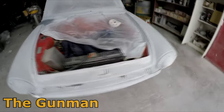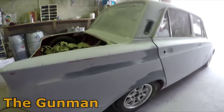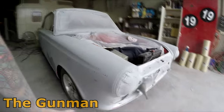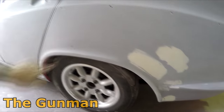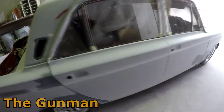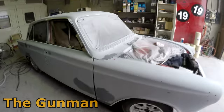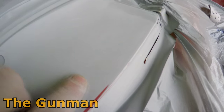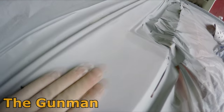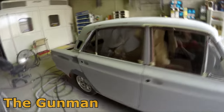Pretty happy with the progress. I've got half of it sanded down with 320 — this whole side, around the front, down here with 320 on the orbital. Did this guard and the other side of the roof. I've just got a few more of these repairs to get onto, then get some primer on it first, and then I'll go around all these edges with 320 grit. Some people ask why I don't use guide coats — simple answer is at the moment I have to pay for it and it's not cheap. I find it not 100% necessary. I can see there are some deep scratches — 180 scratches — so I know I need to feather them out a bit more. But if you use your eyes and you've got good lighting, you should be pretty fine.